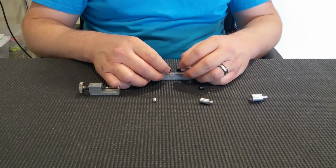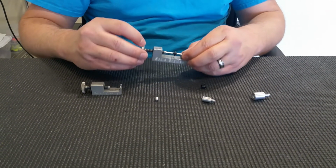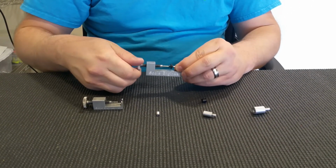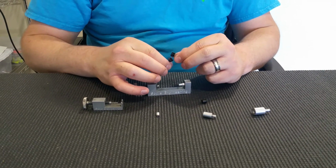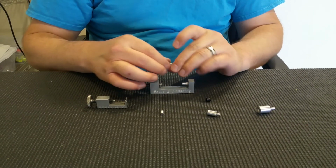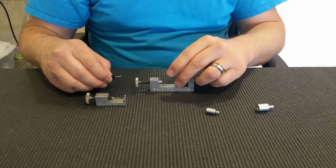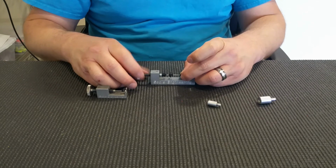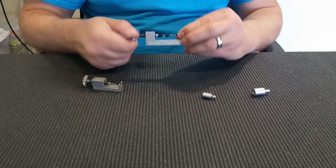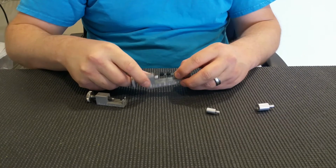And for our rims on our axles and pretty much all of the Viper parts, I have it set up to where if you do 4 full turns, it gets you exactly where you need to be. The rim and the axle are flush inside of there, and it's designed to be put together that way. Makes assembly for us much easier. Same thing goes on this side. Spin everything, make sure that it's all perfect. And now this one, you would also go 4, but just for video's sake, I'm going to go 5.